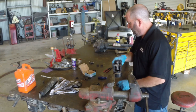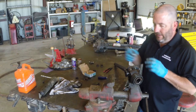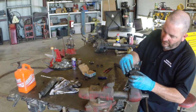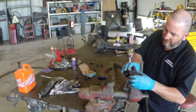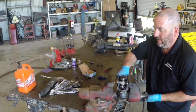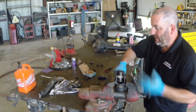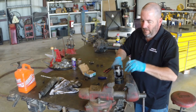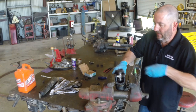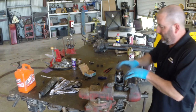That cup is pressed in pretty much all the way. Again I want to engage my needles from both cups into the trunnion so none of my needles are stacked up. I'll press this guy in with the vise. Now that I'm that far, we can go ahead and finish this one up — put some clips in it, then put the grease zerk in and grease it up.